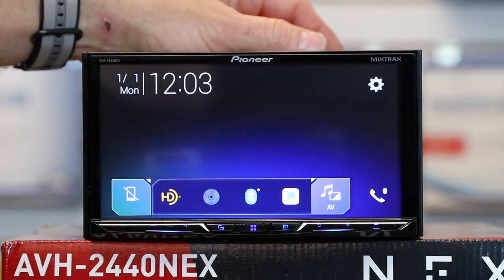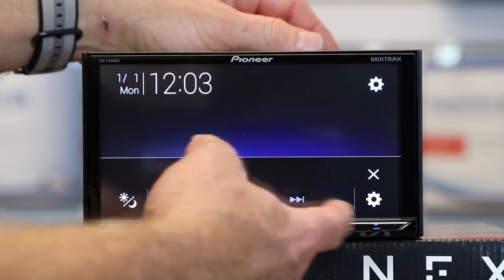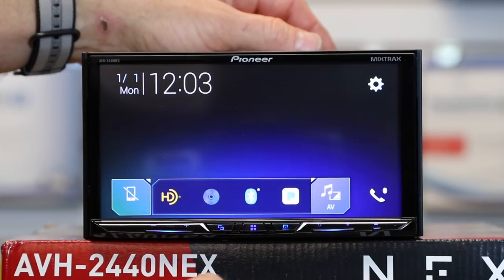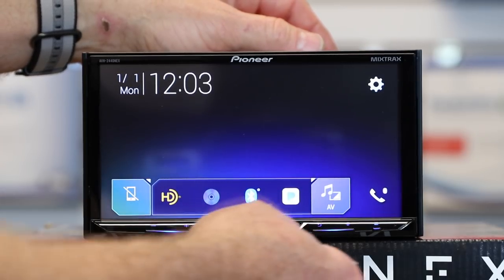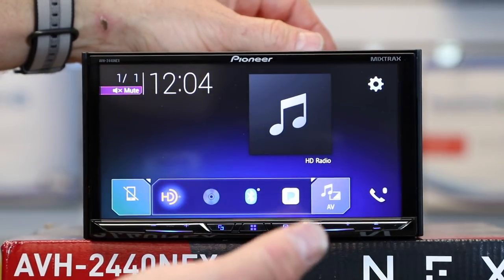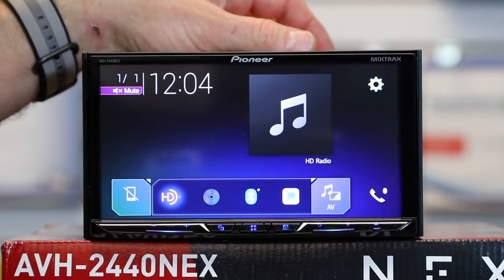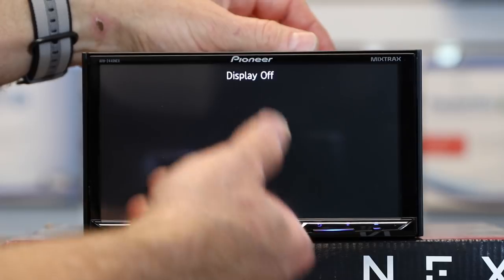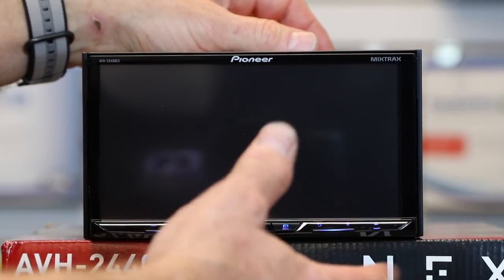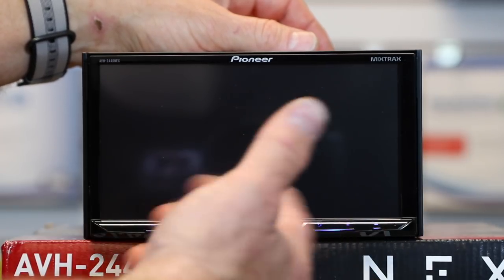The delay source menu bar brings up an overlay for when you're in app radio mode — you might need to change tracks or get into system settings, and this is how you do it. You can also use it as a mute control by pressing and holding it. Next to that is the back arrow, which takes you back one function. If you press and hold it, it'll also shut off the display — the display goes dark but all features still work in the background. This is nice for nighttime driving to prevent eye fatigue.